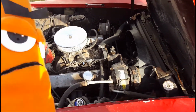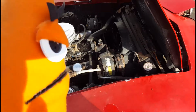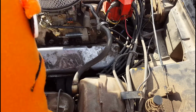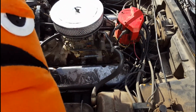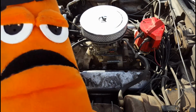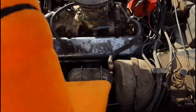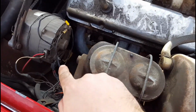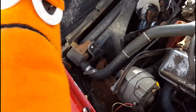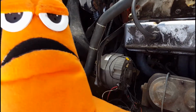We did start it, and it's very high idle. Follow me. So that's the adjustment for the high idle, right there. We're gonna back that out a little bit, get our idle down. But while we're under here, we noticed something else. Right down in here, underneath the alternator is the bolt for the A-arm bushing. That's rattled itself loose. We're going to take care of that too. So hopefully in a few minutes, we should be good to go.